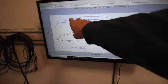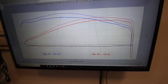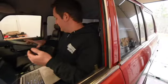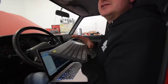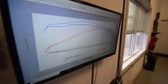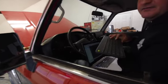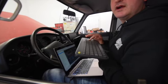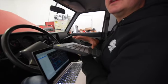The blue line here is torque, the red line is horsepower, and the black line is our measured air-fuel ratio, with RPM on the x-axis from 2,500 to approximately 6,000 RPM. It's smoothed out quite a bit since the original pull. Overlaying the last pull with the updated calibration, we picked up 28 foot-pounds of torque at 4,000 RPM and 22 horsepower at 5,300 RPM. Air-fuel ratio is much better — we're in good shape and cleaning up really well.